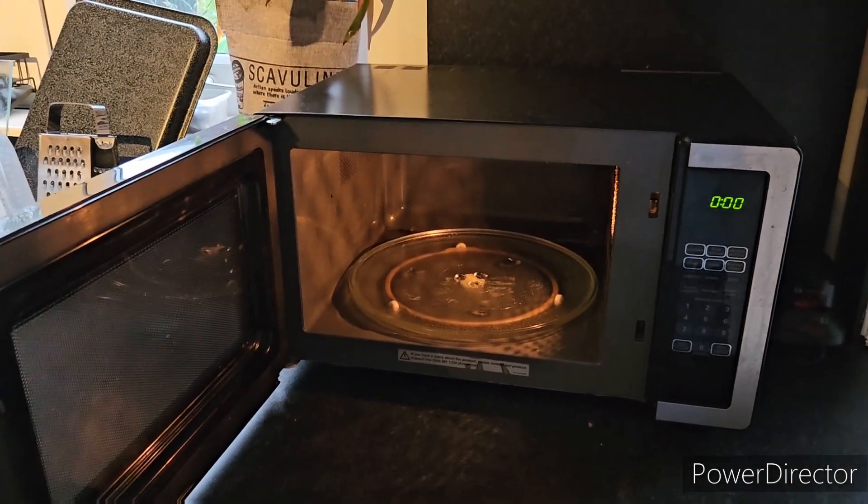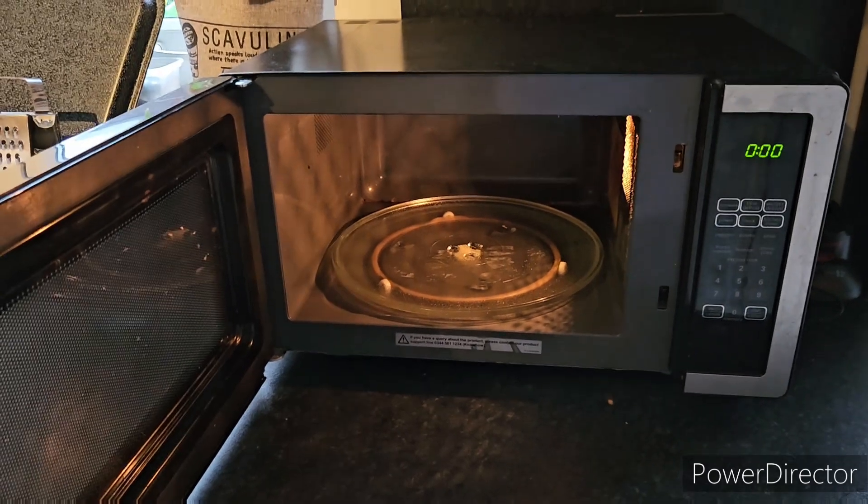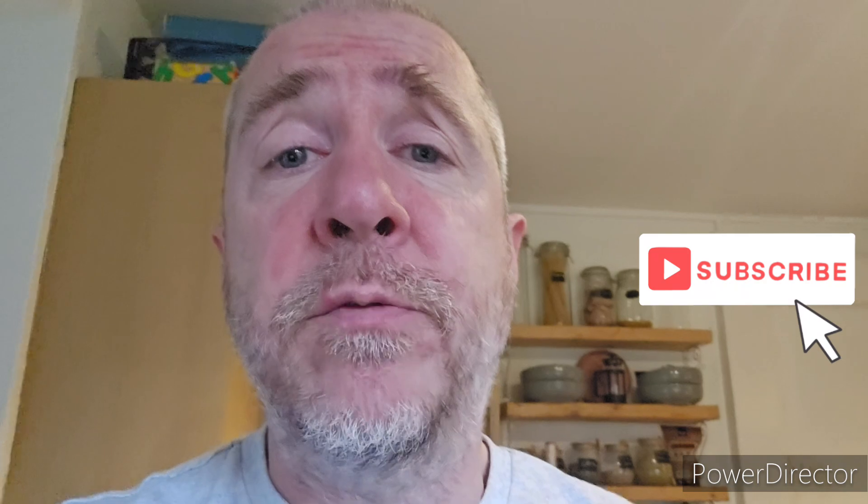Don't throw these away — either bring them to your recycling centre or contact your local scrapper, and they will be glad to have this and scrap it out for the components inside. It's been a bit of a whistle-stop tour on the components of a microwave and why us scrappers love to scrap them. They are great things for scrapping. The transformers are more commonly now aluminium than copper, which is a shame, but if you find one of the copper ones you're doing well — nowadays it's probably 10 to 1 aluminium. There are still other goodies inside though: small transformers, small motors, and that magnetron. If you enjoyed this one, please hit the like button and subscribe to the channel if you're interested in electronics and electronic teardowns. Thanks for watching, bye for now.